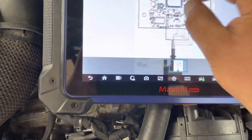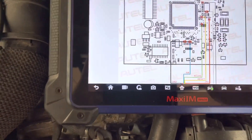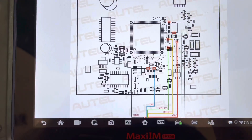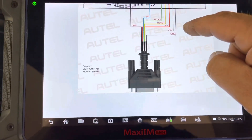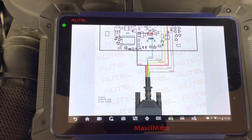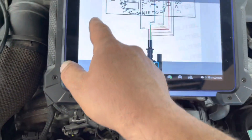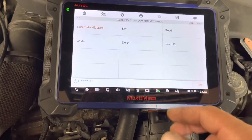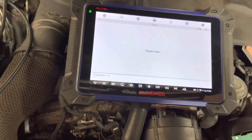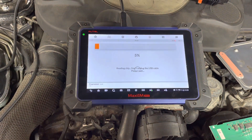Accordingly you can directly solder on the circuit board. Let me show you guys and try to zoom in a little bit. Here we go — if you look at the circuit board and this diagram it matches a hundred percent. You just have to make these connections properly. I'm using the APA106 connector which is right over here, and the connections are exactly as shown. I have not tried to read it yet — if you have a good connection with the solder points we shouldn't have any issues. Let's hit Read.